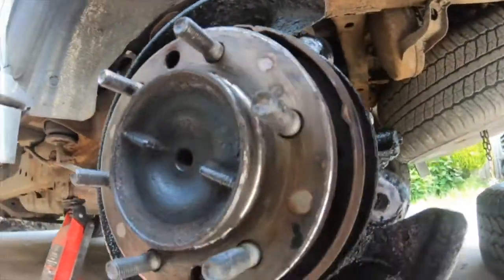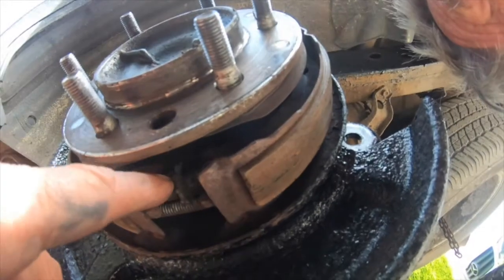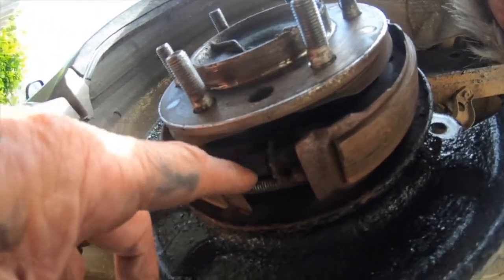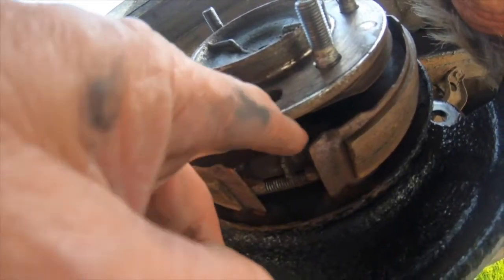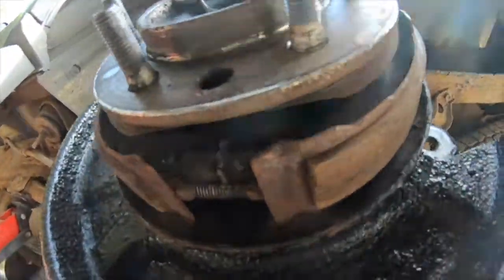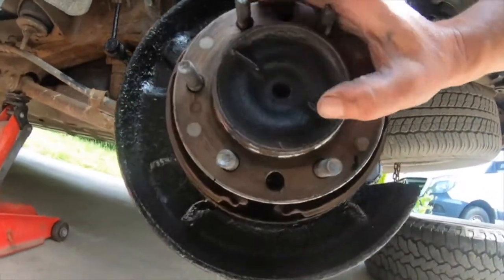I'm quickly just down here, if I can show it you. I'm not sure I can, there's a little wheel there, a serrated wheel. It's like a little cog where my finger is. And that is your adjuster to push out your brake shoes. And what you've got to do is line it up through there